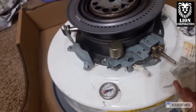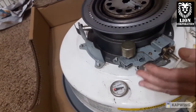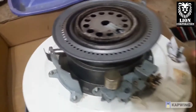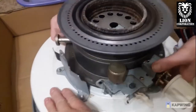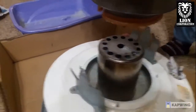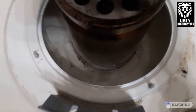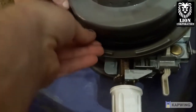We're going to put that knob back on there for a second and raise the wick up. Once you've got that wick assembly out of there, you can take a look in your tank — just make sure it's not dirty. It's a good time to flush it out if you need to. Turn your wick assembly over and see — sometimes this gasket sticks under there and you can put that gasket back on.